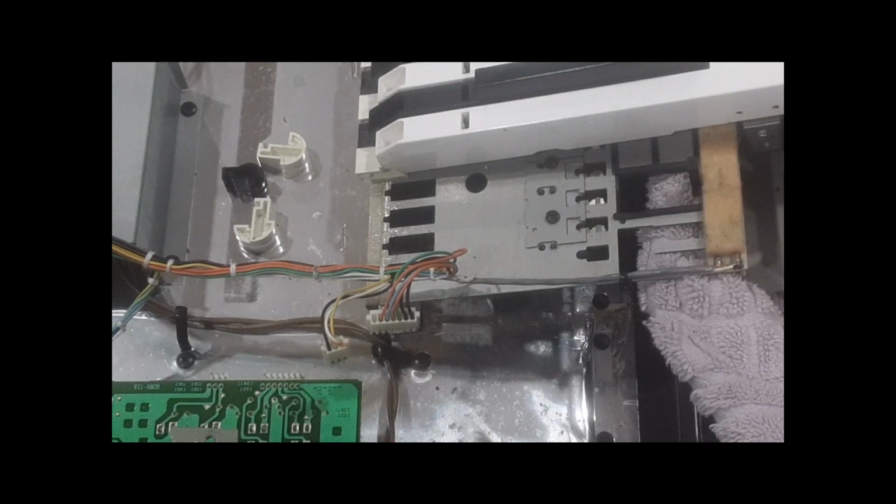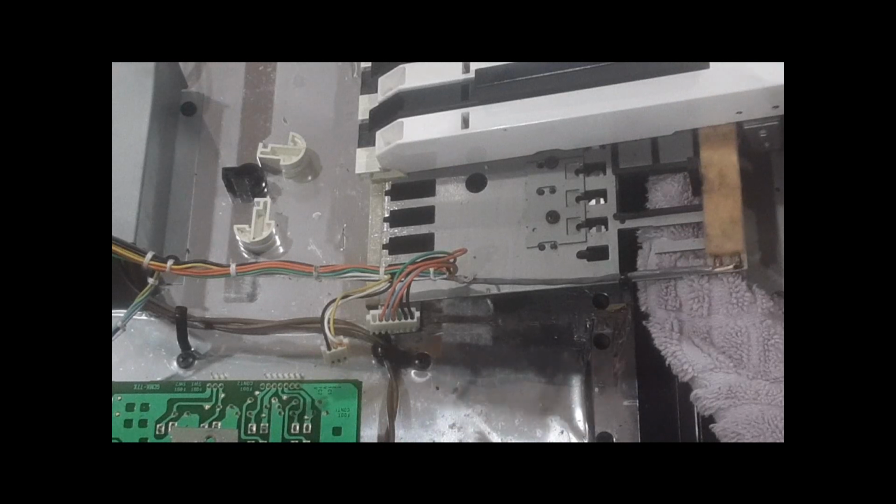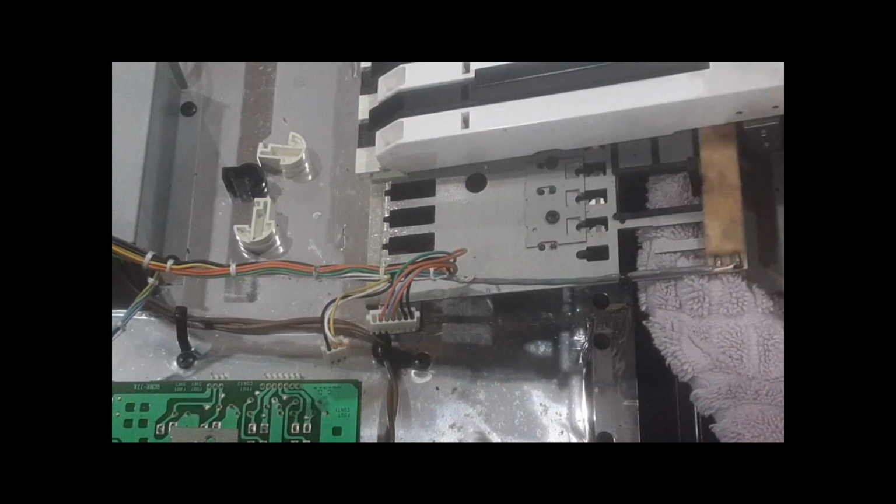And then after you bottom out the key, you push against this little strip, and that's the aftertouch, which, as you know, can give you expression. Here's the little flat area that pushes on the aftertouch. And this is a common aftertouch. Some keyboards have an individual aftertouch for each key, and that is possible with MIDI, but Yamaha said, no, we're just going to make it aftertouch for everything. So this is one aftertouch.